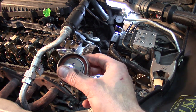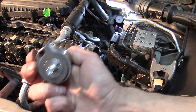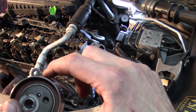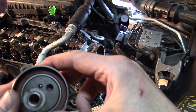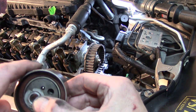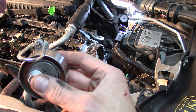I've got a brand new tensioner assembly — you'll see it comes with a little pin already in place. If for whatever reason you are reusing your old tensioner, you're going to need to load it first. On the old tensioner, there is a hole on the lever and another hole next to the big Allen socket hole. You line those smaller holes up and use an Allen wrench or some kind of pin to hold that in place. The new tensioner already has this done, so I'll go ahead and install it now.